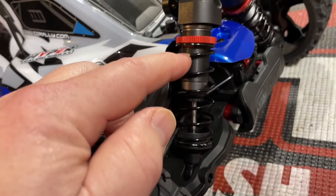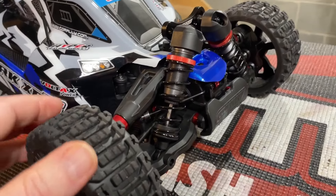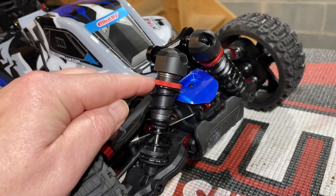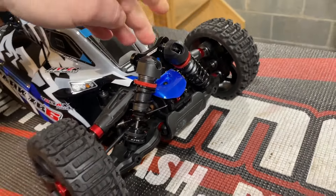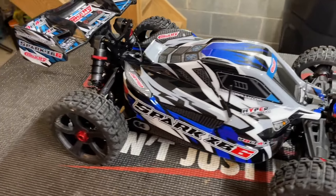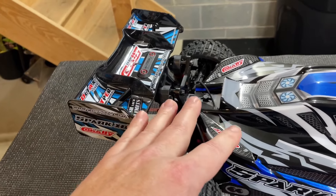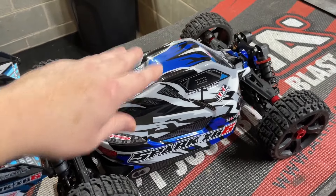So I left the fluid alone and just changed the springs. I did have to change the spring tension ring — I know there's another word for that but I forgot. In the first video, the rings were down really far with the medium springs, so I wound them up considerably, leaving barely a half inch at the top. It felt pretty good, brought the height up a tiny bit, doesn't have as much sag now. I think she'll take those heavier jumps a lot better. I did the same thing front and rear — the rear were actually pretty good, they just needed a heavier spring.